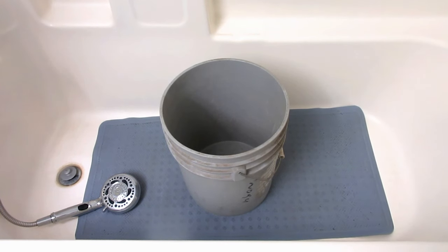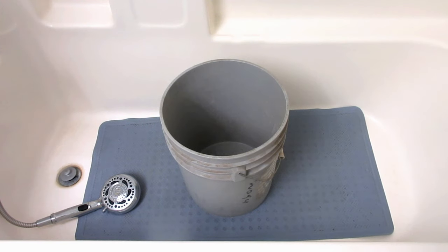So my point with this is, once you start putting chemicals on the machine, wherever you are, you have to go through the whole process. You put on your degreaser, your chemicals, you scrub it, whatever. You take it someplace and spray more stuff on. You wash it, rinse all the chemical off, dry the heck out of it to get it very dry. Then take it back and you have to oil it and grease it. It's all like a big sequential process. And again, once it's washed and dried, the quicker you can dry it good and get lubrication back on it, the better.